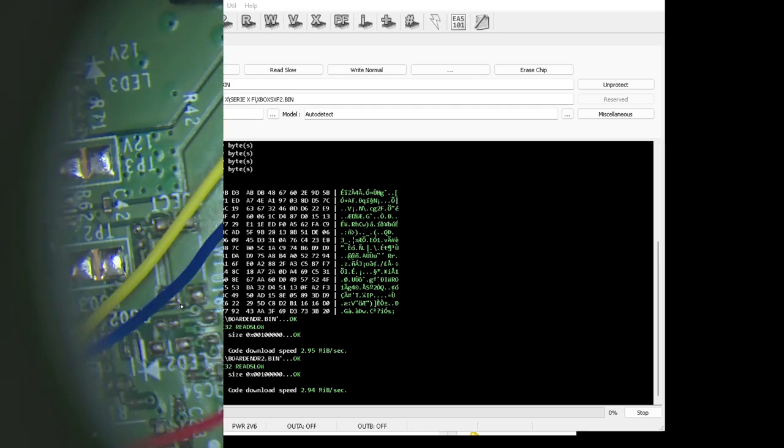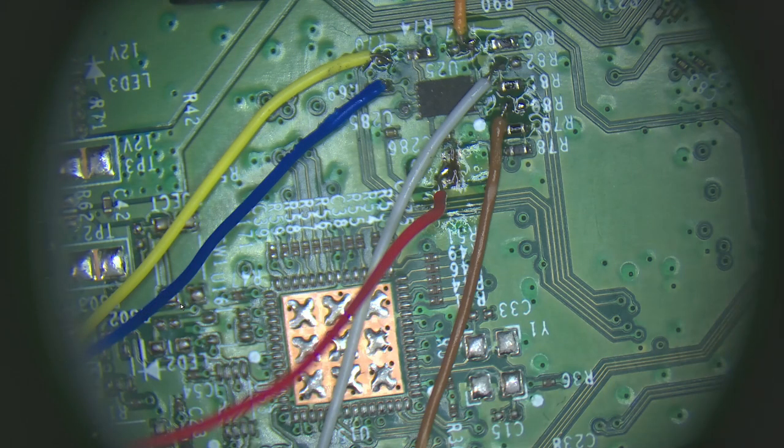Okay, so we've got the board E now wired. So we're going to dump board E. I've done it the same way as I did the other one, just cutting a little bit of track. Saves so much hassle, taking resistors off and so on. As I say, it is quicker to take the chip out. But the problem is, if you're not overly experienced with hot air, and this chip is tiny, and you lose it or brick it, then it's game over. Because if you lose the chip, you can't repair it, because it's the data that's in it. This is why I'm going the long way around, but hey-ho, thanks for watching.